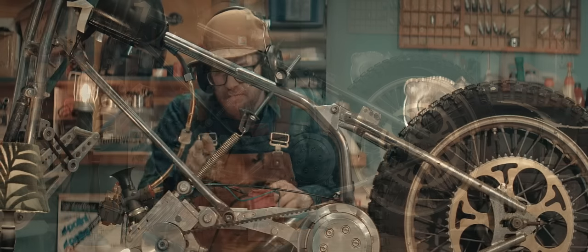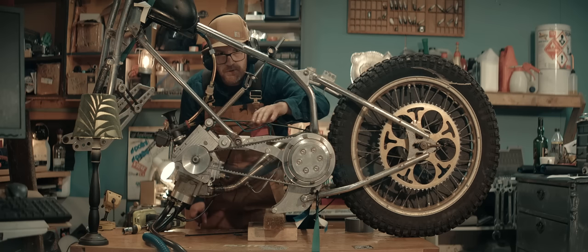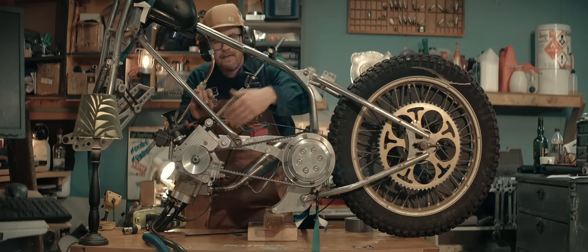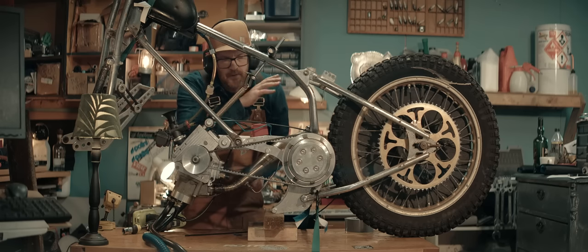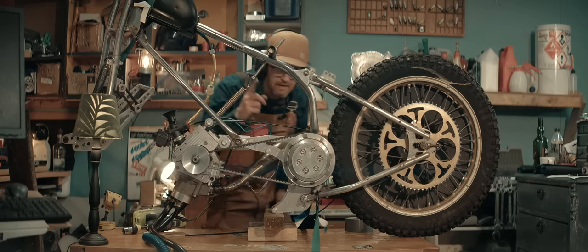You saw how this works. Now the tension of the spring and the weight of the rollers decides which RPM the variator is variating at. Fine-tuned, you can stay at max power all the time. Plan for running on the dyno is running too heavyweight, so that it will gear out completely and then we'll start a run. In that way the ratio will be fixed. Let's see if I can get what I've filmed up until now edited today. And then we'll have time for some dyno runs tomorrow. Maybe. Maybe.